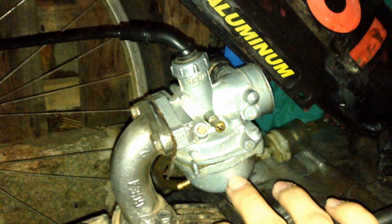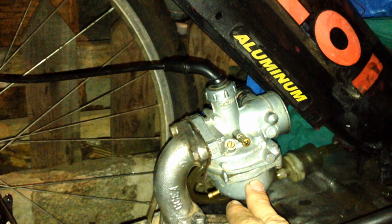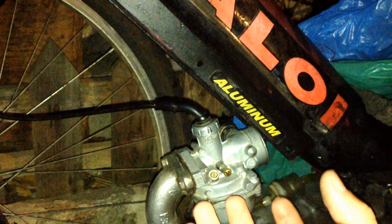This is the carb, and this is no child's play. Even the carb reservoir is made out of metal. And this is in fact a gasoline reservoir. Some people think that gasoline and ethanol carbs are all the same. They're not. Ethanol carbs are bathed specially in a different chemical, because ethanol will create a sort of white goo on the carb reservoir.